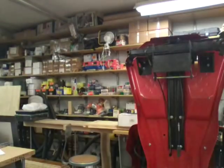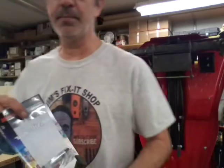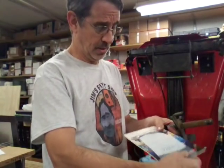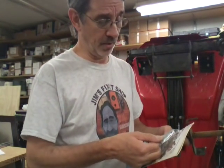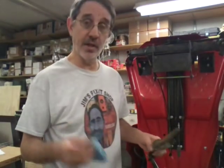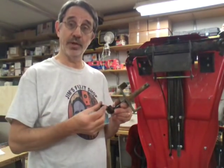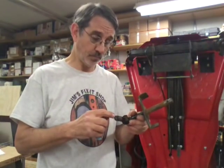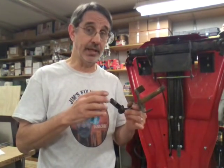I have a product from Applied Industrial again. They have two different products over there. And this was a sample he gave me. Well, it's product they sell, but he sampled this out and gave it to me to see how it works on this. There's two different kinds. This brand, or I should say kind, it doesn't say on here. This is a retaining compound, but it's quick metal. And there's another brand you can use that you put on here, and you let it dry, and then you machine it off or file it off and get it to where you want it, and the bearings will slide right on. That brand, or style I should say, you put on here while it's wet, you slide the bearing, your tire on, and it sets up and it's on there.